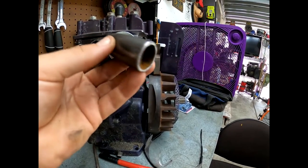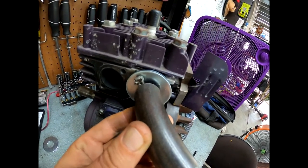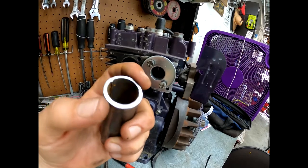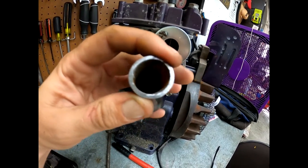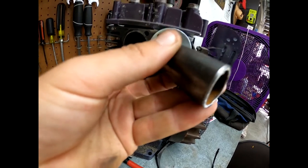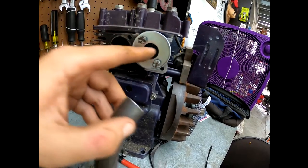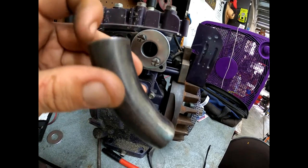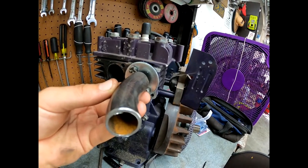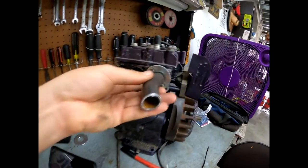I've got my piece of pipe here, got some bend in it, kick it out to the side. But the problem everyone is going to come across — there's no other way around this — the pipe is hitting the bolts on both sides. What we're going to have to do is crimp this down a little bit in the direction we want it to be. It is going to oblong this hole a little bit, but you can port match this with a Dremel. Once you've got everything finished, you can just port match the hole to the inside of your motor to the flange and the pipe — grind it out with a Dremel tool until it matches perfectly. I'd probably recommend anyone just going and buying one of these online, a lot easier. But I'm going to crimp this pipe now so that we can get to those bolts.